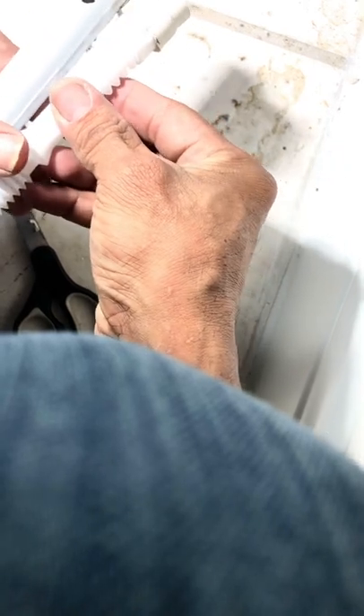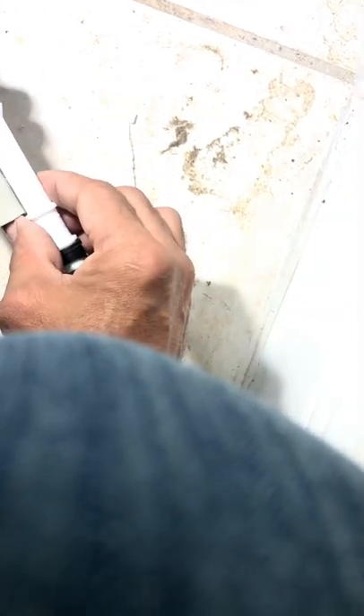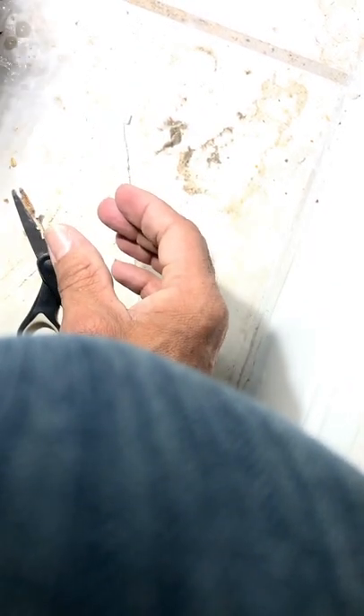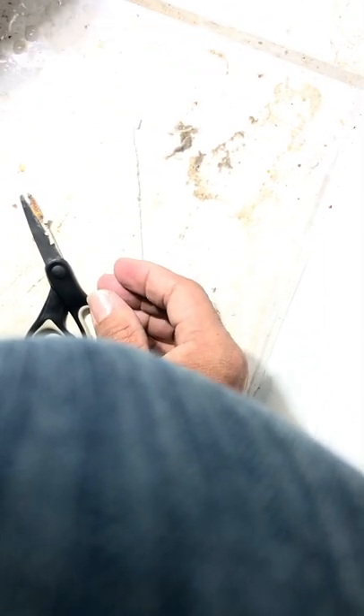So we're going to measure and cut — we want the drain to be a little bit longer. Usually we'd cut there, but because Samsung is shorter, it has something that raises up at the bottom of the drain pan to meet the drain tube. To give you a rundown on why they're so ineffective: Samsung has so many holes, and their idea for the holes is to allow water to pour, but it works in the opposite because warm air will rise.